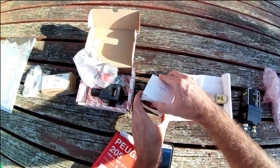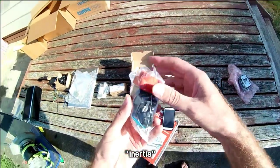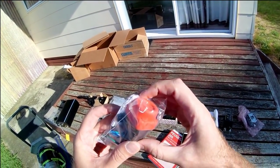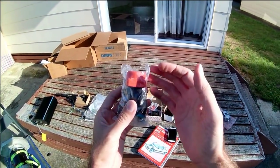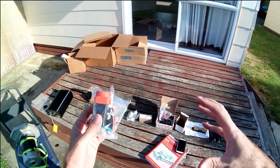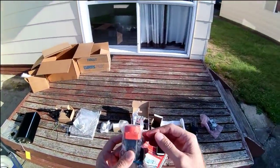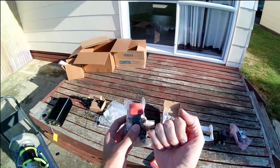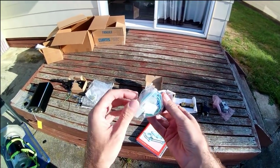The first thing that's not heavy is this — it's called an inertia switch, and it's a safety device. When you push it down it closes the switch. The idea is that if you have a crash, you don't want the circuitry to still be closed and trying to turn the wheels. So this is designed so that when it takes a whack or a knock, it will turn off. It's just a safety feature.